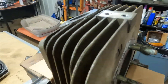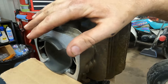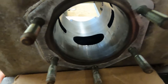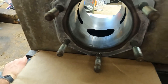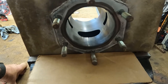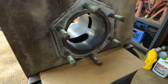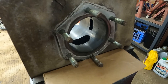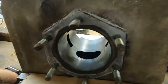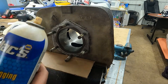The gasket's cleaned up — I've got the gasket cleaned up on that surface, on this surface on the cylinder, and the base gasket's all cleaned up. I scraped all that off with a utility knife, parts-washed this thing, and I started looking at the cylinder — this thing is kind of really really ugly. It did run before I did this. This wheeler is not going to get ridden all that hard, so personally I'm going to hone this, put a new top end in it, and we're going to run it till it doesn't run anymore. Just keep in mind that next time it needs rebuilt it's going to be expensive.